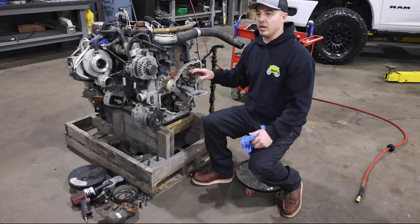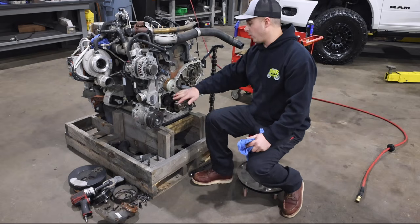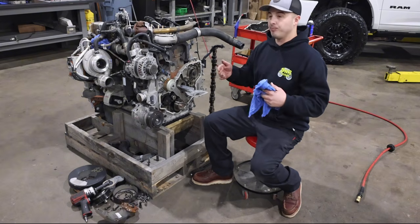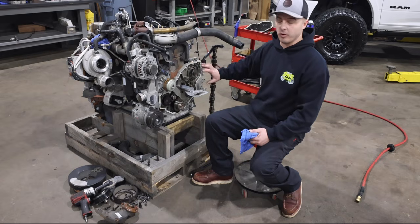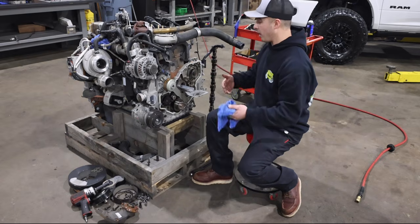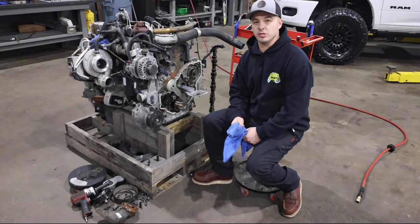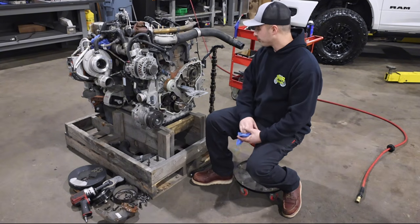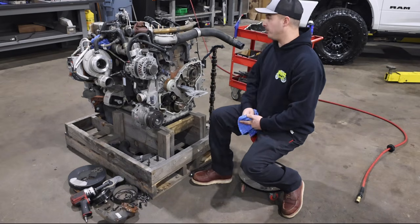So this is the time that you're going to decide the health of this gasket. We've already looked at this one. It's really low mileage. It looks really good, but now would be the time to do it if you need to be. You can pull the CP4 for the CP3 converter to get that out of the way, pull the cover off and do that. It's going to add probably an extra hour or two of time to the job, but well worth it if it needs to be done. And like I said, you just have to make the call when you guys are doing the job.